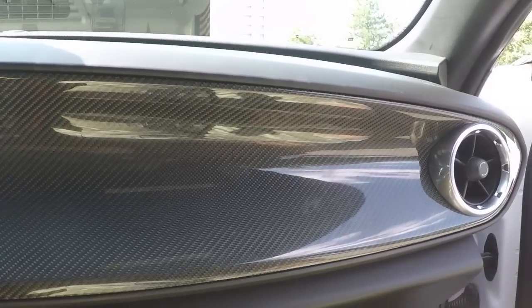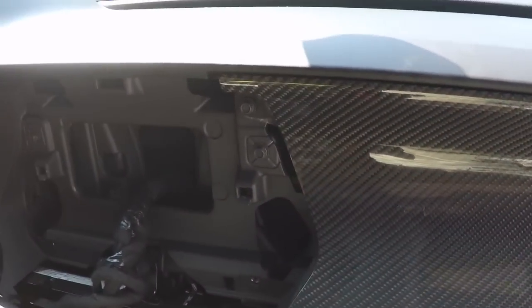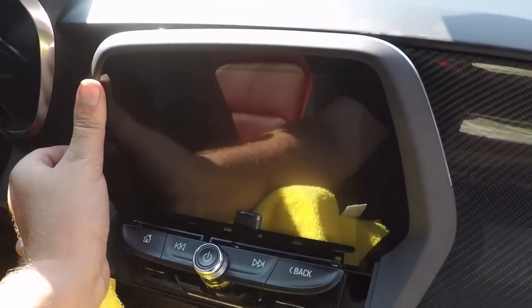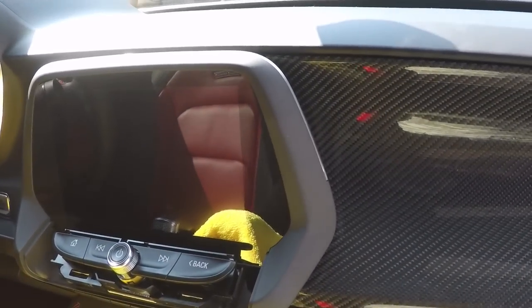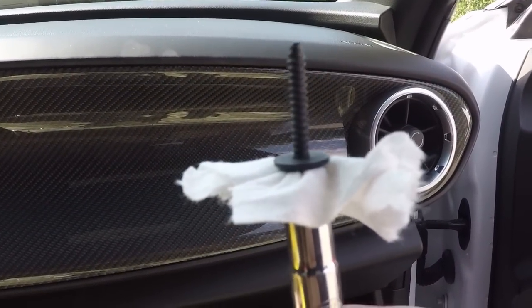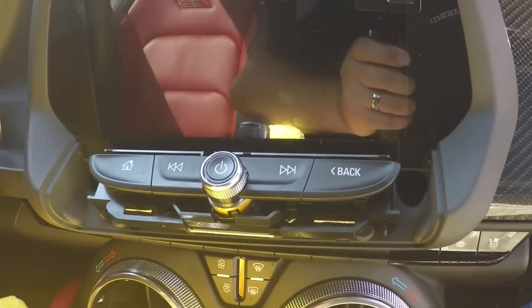It just snaps right in — wow, what a difference already! This just gives the dash a total new dimension of style. I absolutely love this new carbon dash. It's in there nice and snug. When you put your radio back in, remember the top hooks go in first, then reinstall your bolts. We're going to use the mechanic's secret: put a little piece of paper towel over top of your socket, put your screw inside, and you're able to hold it in any position without it falling out — which in this instance will save you a lot of grief.